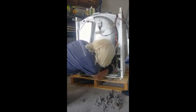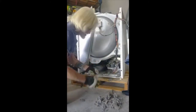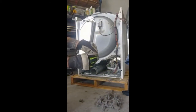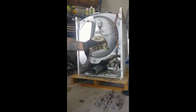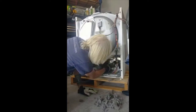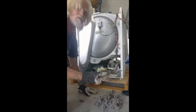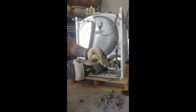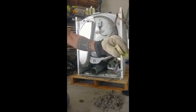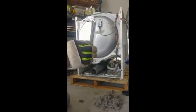We're going to undo the belt off of this tensioner. You see it's so worn out that the retaining clip came out without any issue at all — it just popped right off. Pull that pulley off. Take a look at that. There's that old bushing — remove the old bushing right there.